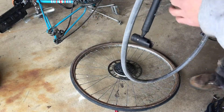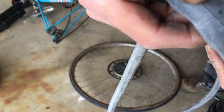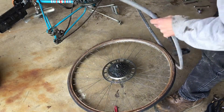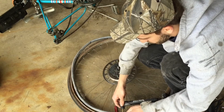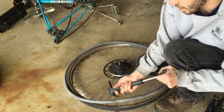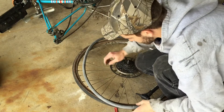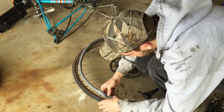When taking your tire off, it's also a good idea to get your tube and find where the leak is. You can see I have a puncture there. Since I haven't spun the tire around, I can correlate the valve stem to that location and find where the hole is, then check the tire for any metal shavings or whatever punctured it.